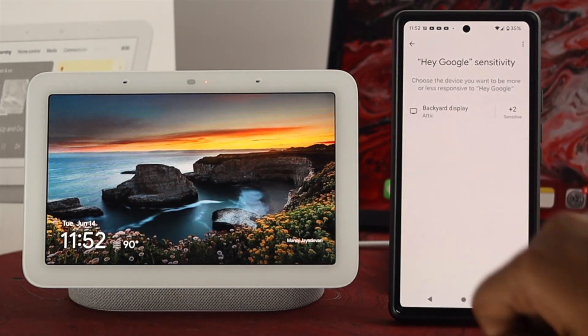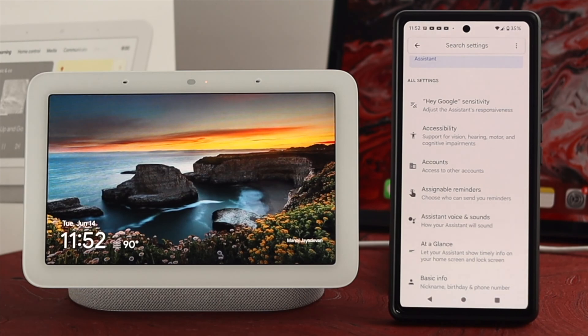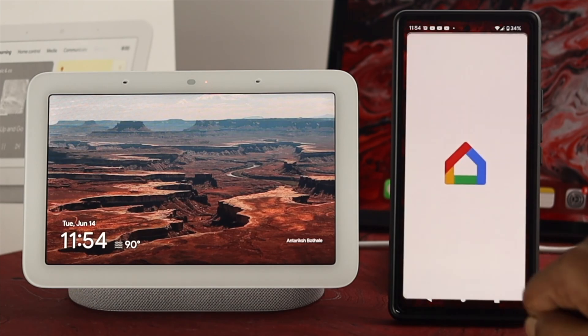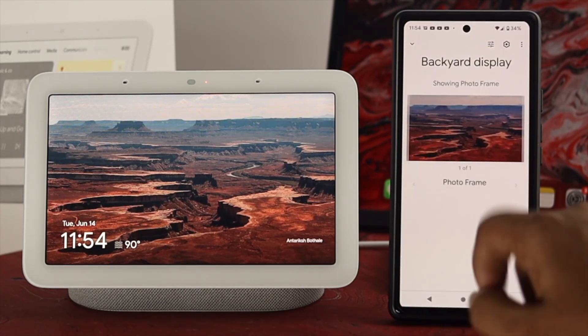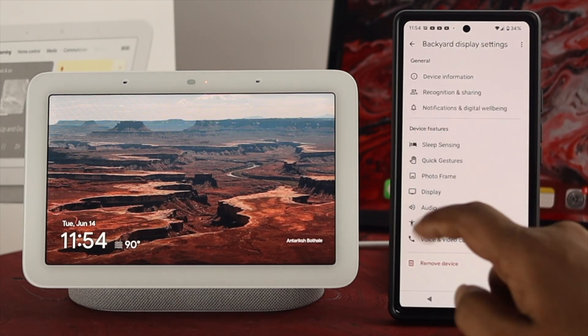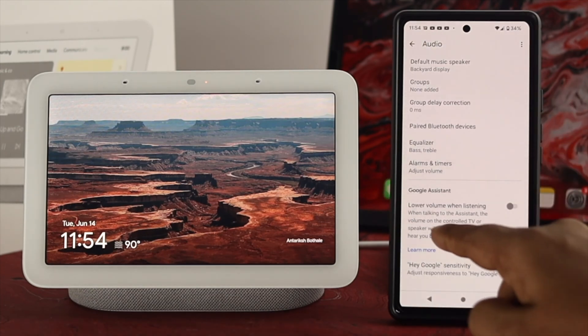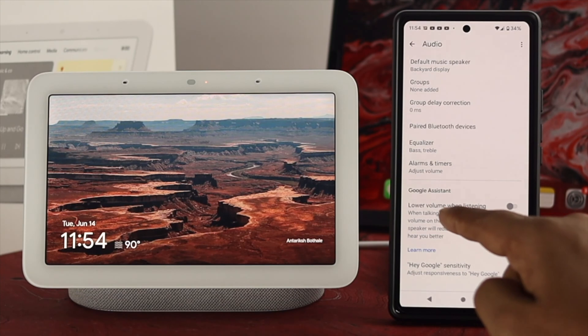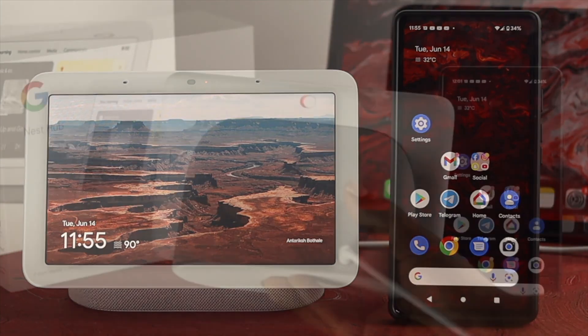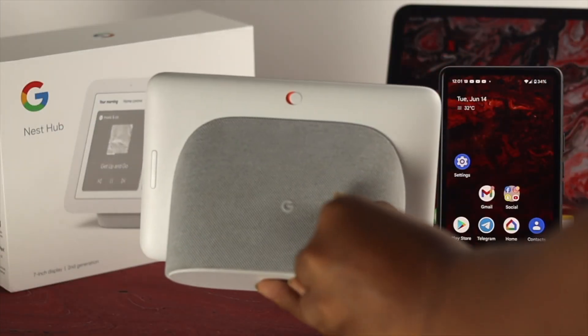After that, just go back and you're all set. Even after checking that out, if you still have the same problem where you can't make your Google Assistant listen to you properly, then the next thing to do — this is kind of like a bonus fix. Open up your Google Home application, tap on the name of your device, then tap on settings. This is going to show you an option called Audio. Tap on Audio, then scroll down and make sure to enable the feature called Lower Volume When Listening. Turn it on, then get out of there and restart your device. Just unplug it, plug it back on, and your problem will be solved.